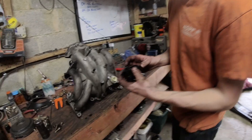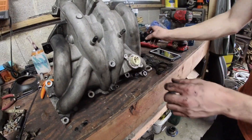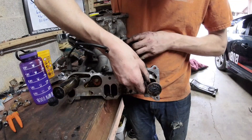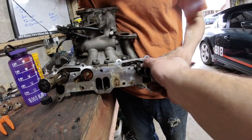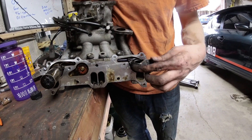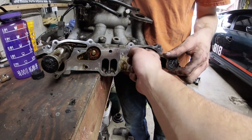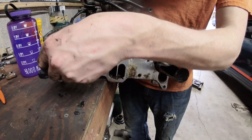We're going to pop the little motor off. This is the drive motor - you can see the gear down there. It spins the shaft, which now that the motor's off I can turn manually and actuate the really grody fifth and sixth port mechanism. All this carbon in here shouldn't be here - it should just be clean. There's also a lot of play in that linkage; maybe that's by design.